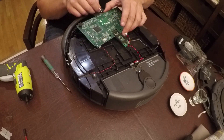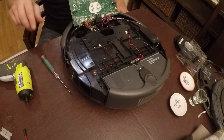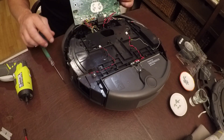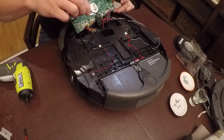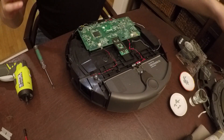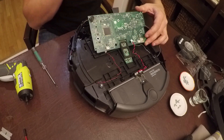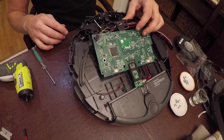I'm going to take this bumper wire off over here. Here you can see what's underneath. You've got all kinds of connectors over here. I'm not going to take those off — I just want this bumper out of my way, so we're going to remove this one. The bumper's free. Now we've got the motherboard loose along with it, and all these proximity sensors on the front. We don't have issues with the proximity sensors.